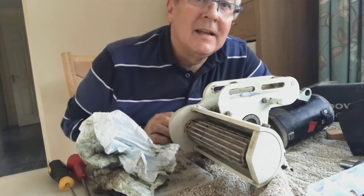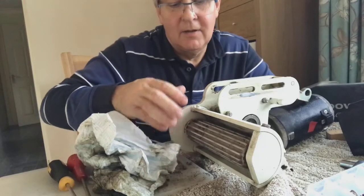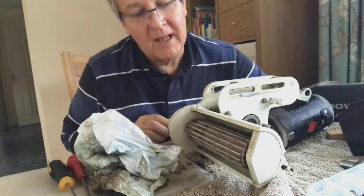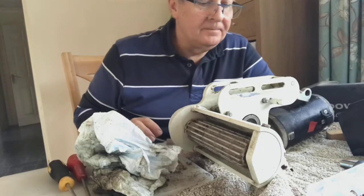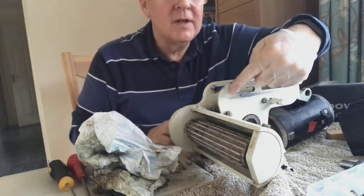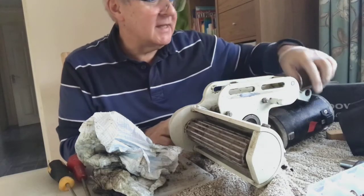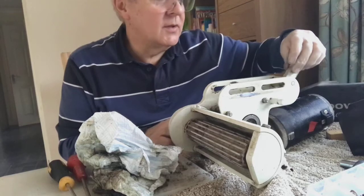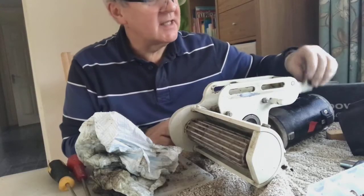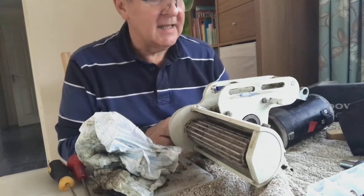So, cleaned it up, it's come up nice and clean. The only thing I regret is maybe, whilst I was able to rotate this, not actually brushing that off the actual roller, but c'est la vie. Having it all been clean now, the area to apply grease, as I mentioned before, is along that edge and along that edge, because that's the bits that actually rub against each other. And then also this, the axle, or the rod that it rotates on, and maybe inside, and the little spacer as well underneath, just to keep all that moving nicely.